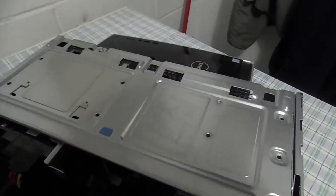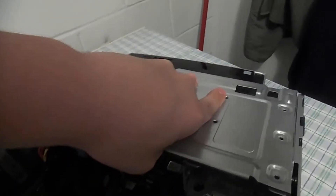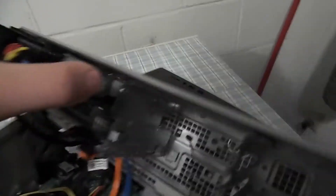Now is when you want to take the computer and lay it flat. Go with a little bit of force and bring that door up. This is going to expose the interior of your computer. Here you'll see a PCI Express slot and two DIMM slots. Now, to remove your hard drive that is up here, we can't do it yet.